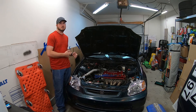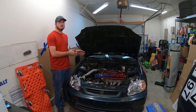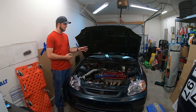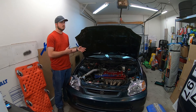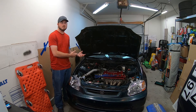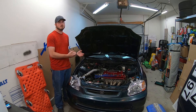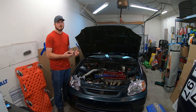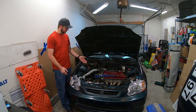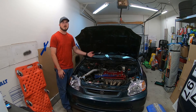Why do you want to do meth injection — specifically for a supercharger? You want to do meth injection to help cool the rotors. Since this thing has no intercooler on it, intake temps get out of hand, and heat also builds up in the supercharger itself. The meth injection helps cool the rotors because if the rotors expand too much, they touch the housing and bad things happen. So in my case, we're injecting into the intake stream to help cool the rotors and keep them from overheating and touching the housing.